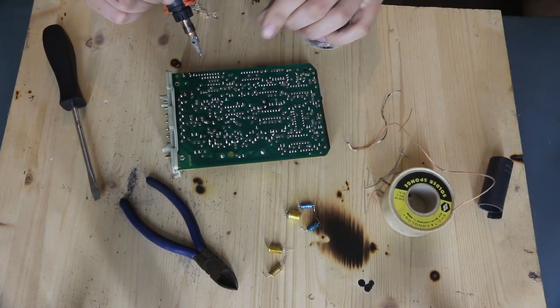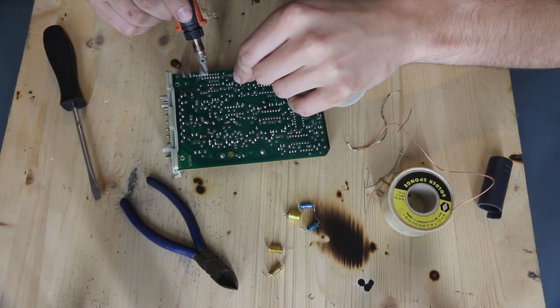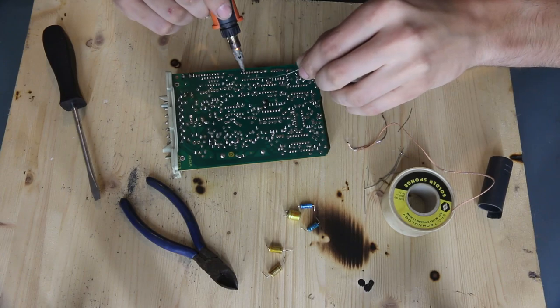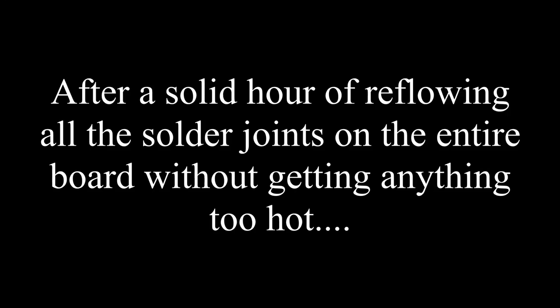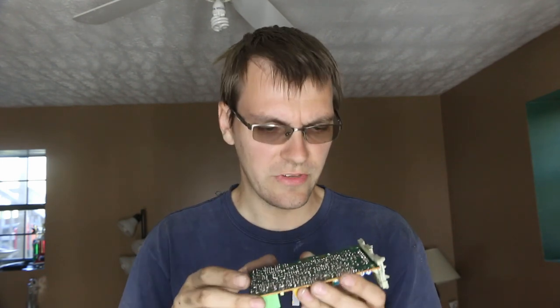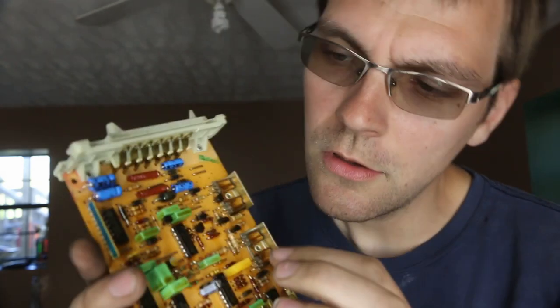In some cases, you may find one where you touch it and the solder kind of goes away — you can add a little bit if needed. We finished soldering all of the contacts on our cruise control amplifier. I had to go back with some more lacquer thinner and clean out a couple of spots where the solder was acting funny when I hit it — you could tell it was contaminated. With this all put back together, new capacitors installed in the right polarity, we're going to stick this thing back in the metal cage. We're not going to bend the tabs back down — let's go out to the car and give this a quick test.